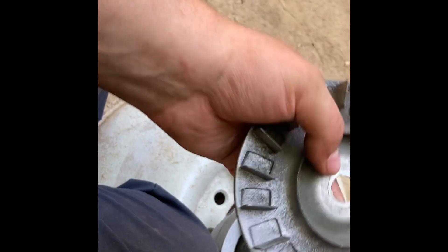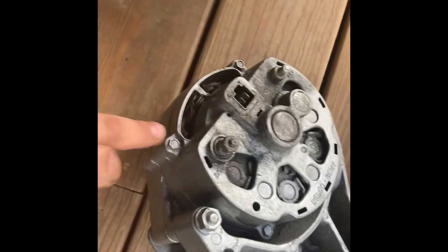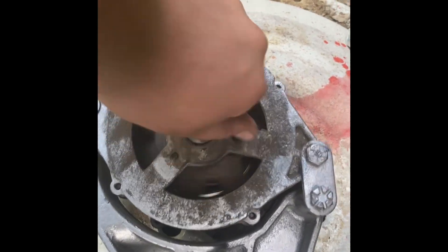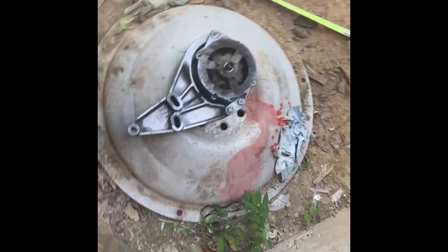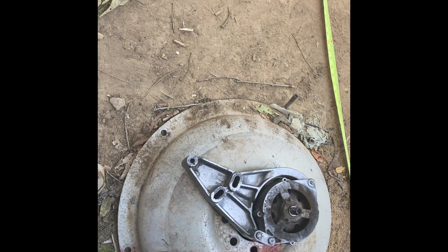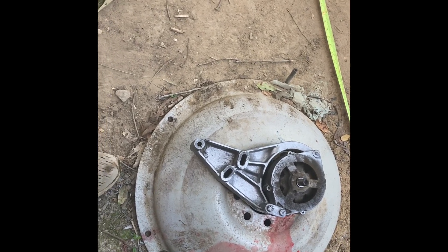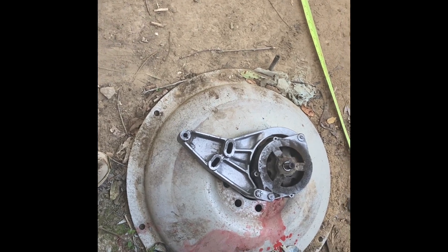I went ahead and pried that off — it's off now. I don't have access to what I need to get to; I think it's the back bearing that's bad, so I'm going to take these bolts loose and crack the head off. Got the bearings out and they're the greasable kind — they just need greased because after 60 years the grease dried out. This bearing is a press-fit so I'm going to take a socket that fits right over it and hammer it in. Got it back together after getting the bearings greased; it's nice and quiet now and a lot harder to spin, so it'll be good.